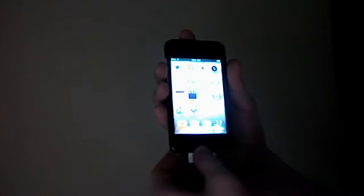It's really easy. All you gotta do is take both hands and put your thumb on the home button and your top finger on the power button, and just hold them down. You'll see the slide to power — don't even touch it, just keep holding it down. Wait a couple seconds. And once you see the Apple logo, you're done.